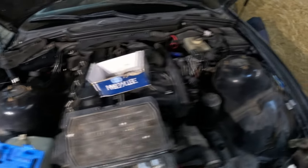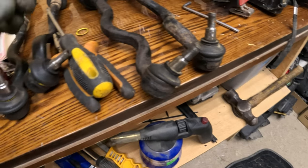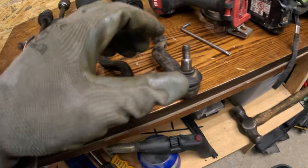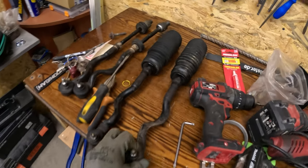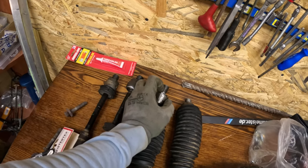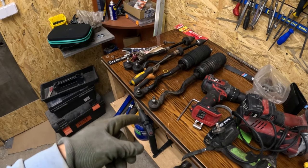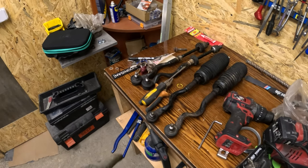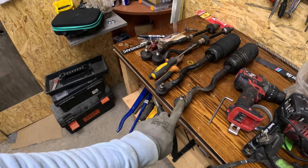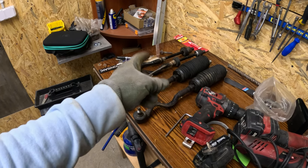Both sides are done now. I saw some damaged rubber so I'm gonna try to remove the rubber from my old rods and install it onto the one with a damaged piece — this one looks alright. I also bought thread lock adhesive and I'll be putting it on, but I'm not installing it today because I want to receive all the parts I left with the guy who is rebuilding the angle kit. Today I'm gonna try to replace this rubber part and cut the damaged thread so we'll have everything prepared. When we receive the rebuilt angle kit, we'll be able to install it straight away.